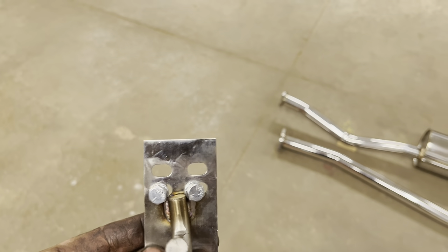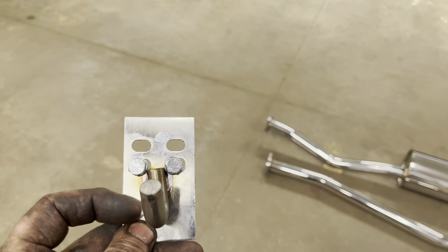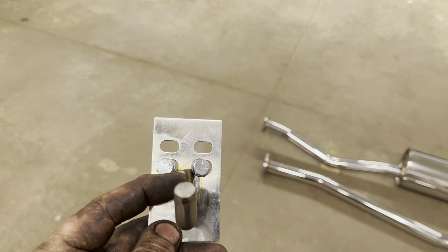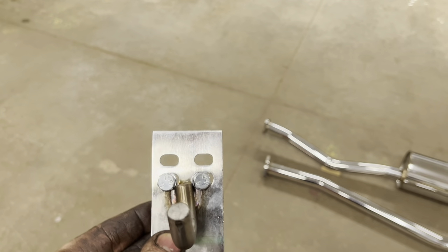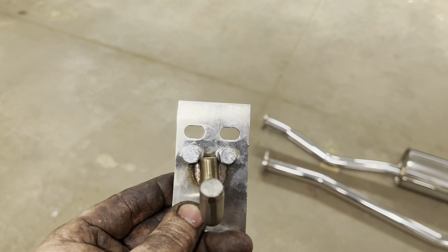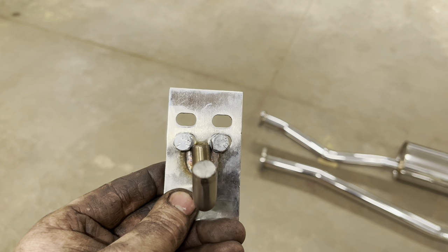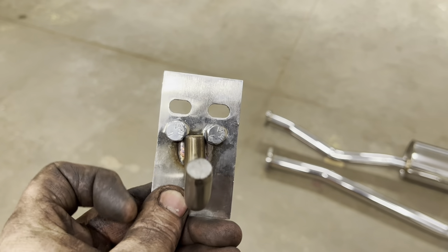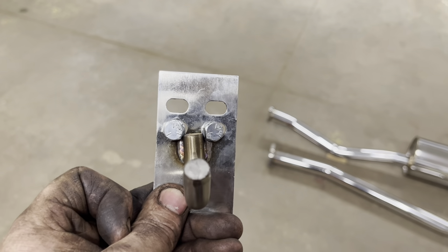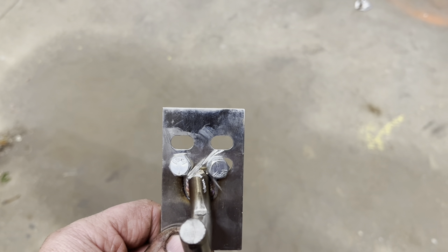One of the minor issues you can have with these is — you see how this bracket's made — with production tolerances, the ends are so close to those bolts that you really can't get a wrench or ratchet on there once you get it up in there and you're finally tightening it. So I like to go in with a grinder and just nip the corners of these to give me some room for a socket. Now I've got room to actually get a socket in there and work on this.